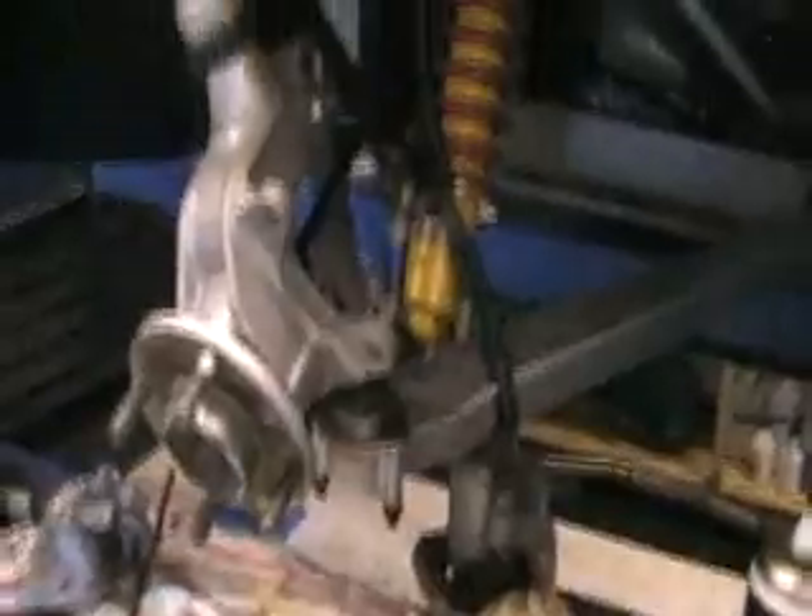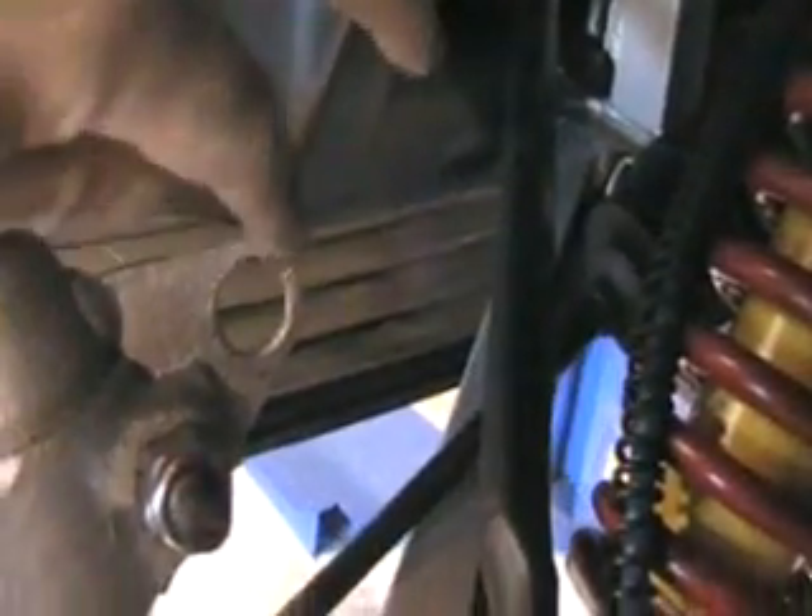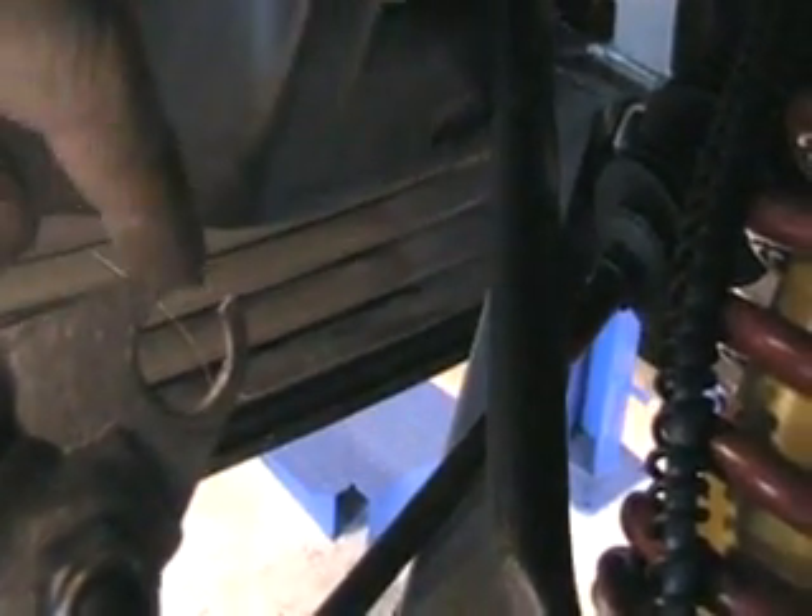A little bit more progress — there's the upright on. A little tip: when I took it all to pieces I didn't want to have to undo my brake pipes and then bleed them again, because that's a bore. What I did was on the little bracket where the brake pipe goes through, I just took a little nick out of it with a grinder. I've got Goodrich hoses on my car — you can see they've got a plastic covering but there's stainless steel hoses underneath. It just fits through that little cut-out nicely with a rubber grommet in there, so it saves you having to bleed all the brakes and undo all the pipes.